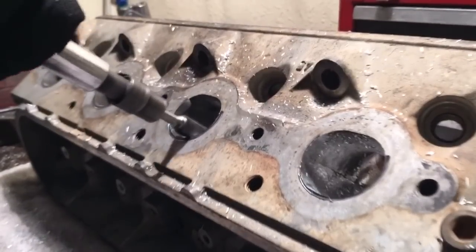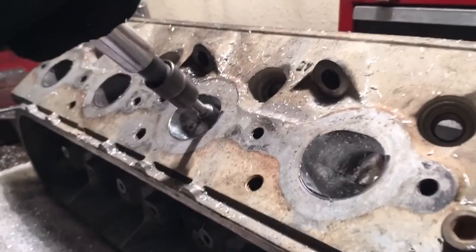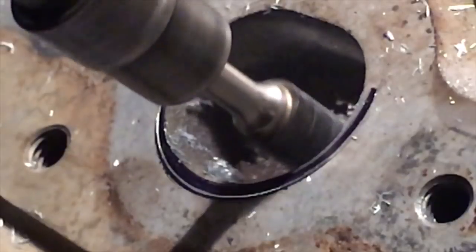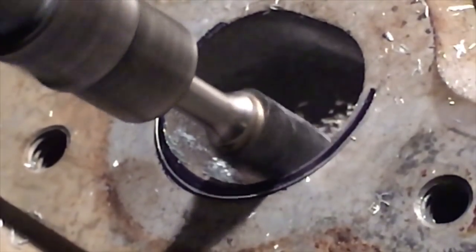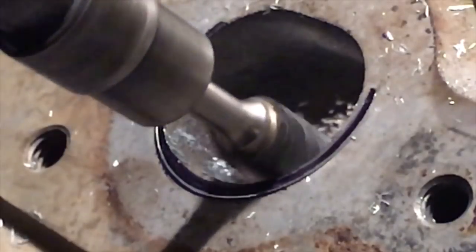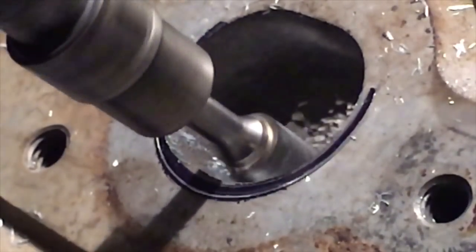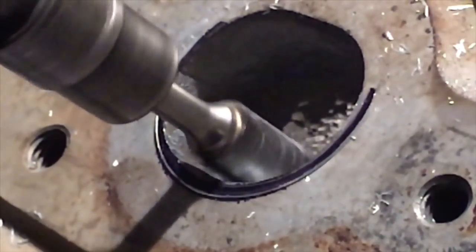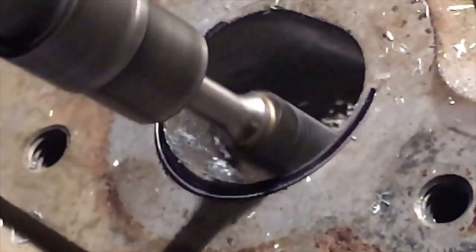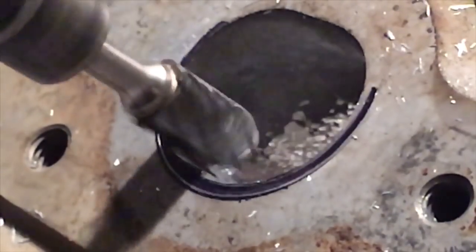A little bit of cutting as I'm raising the roof on that exhaust port. I wanted to show how I maintain control over the RPM of my cutting tool and always keep it moving and just work the aluminum. Don't let the burr sit there and dig itself down, creating ruts and things that might give you issues trying to get them out. Just keep it moving.